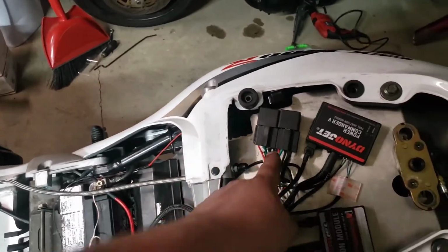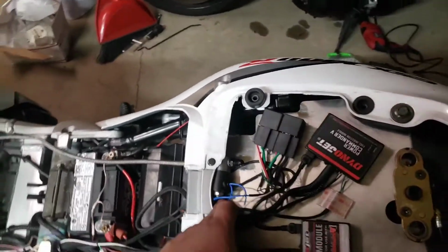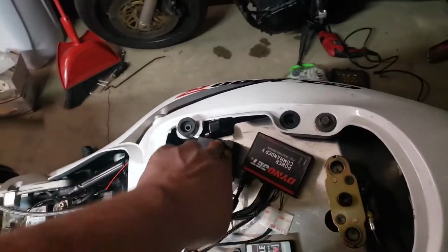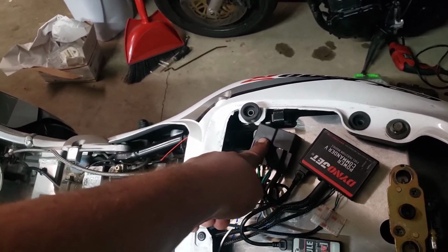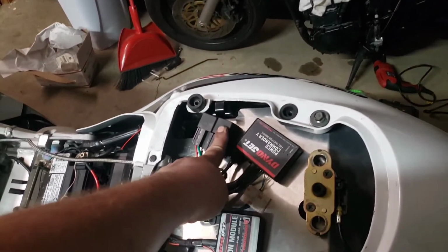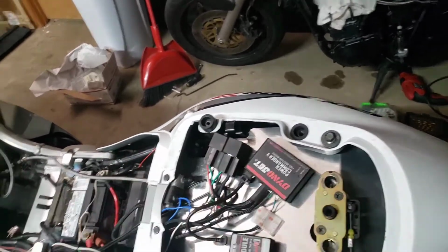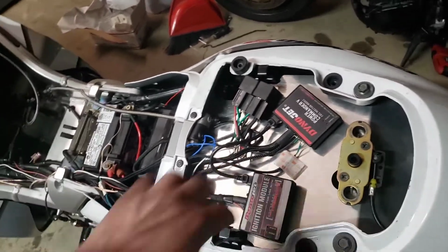So what I will be doing is taking that wire that's feeding that relay, right here, and I'll be using that same relay, but I'll be wiring it up to the purge solenoid that we're going to be installing. This solenoid's going to be moving. The other map switch relay is going to stay the same, but instead of tripping at the same time, we're probably going to trigger it with the output because I won't have a button anymore. So we'll have the output from the controller controlling that. An ignition retard output or whatever you want to use it for. It's just an output, 12 volts. So we'll use that to trigger that relay to tell the power commander to switch, because the power commander wants to see 5 volts, not 12. So we've got to leave it in itself.